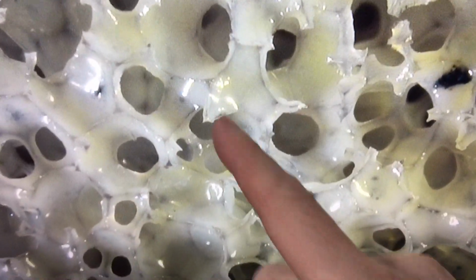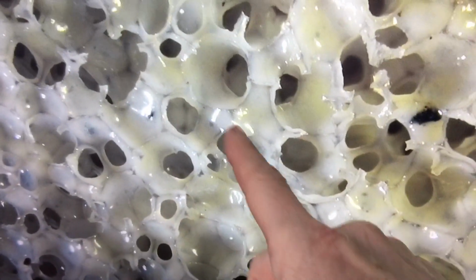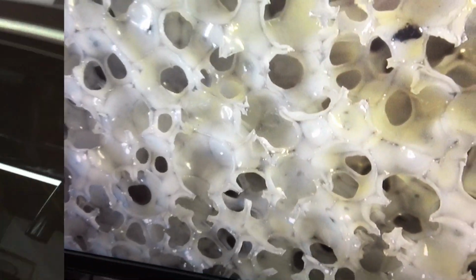However, if it isn't clumping, and it sometimes isn't all that bad if you're working on some real hard clear coats, that will stop the compound from going into the pad, keep it to the surface, and make a more effective cut. But you really do have to watch out, because what will happen then, it'll start to clump, and then you'll get the pigtails that you often see. It's a balance that's really hard to keep if you don't know what you're doing. So again, I'm going to say, clean out your pad between every pass.